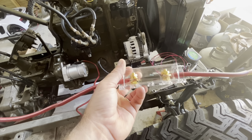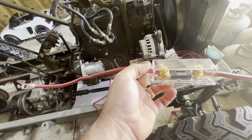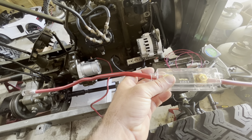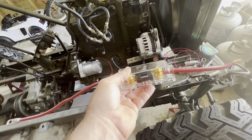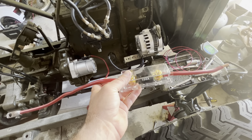It calls for a six or eight gauge wire. I don't have either of those available here in the garage, so I'm using a four gauge wire. They specify six or eight so you don't use too small a wire and cause an overheating or melting issue, and subsequently a short or a fire. Using a larger wire, we definitely won't have to worry about that being an issue.